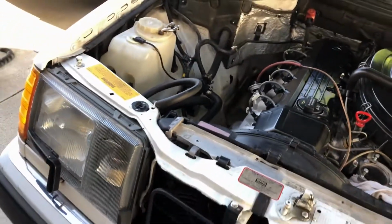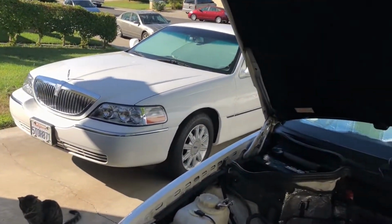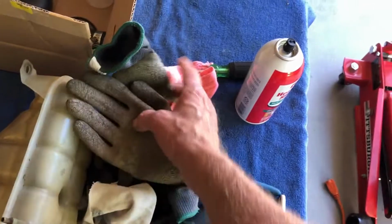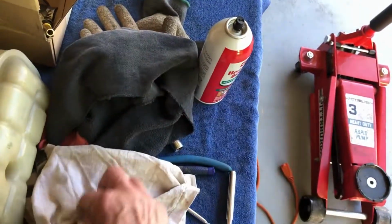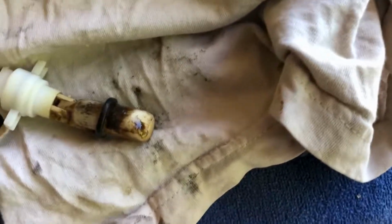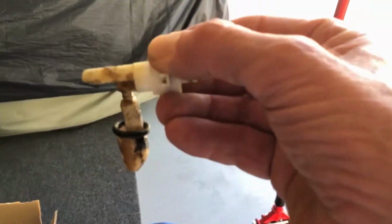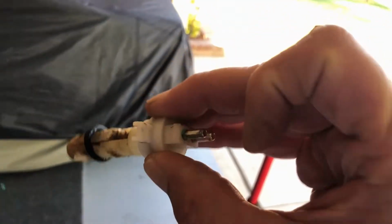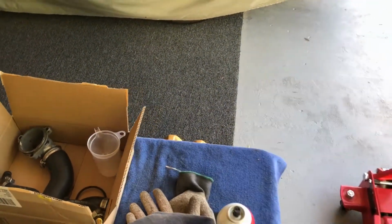It is the next day. It's going to be 100 degrees again. I'm going to clean this tank out in the kitchen sink. My wife didn't catch me. There's the level sensor. I'm sure it works, but it's just gummed up. I'll clean it, and then test it for it to turn on and off. I'll do it with an ohm meter and double check it.